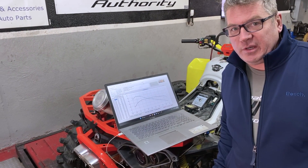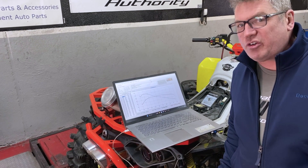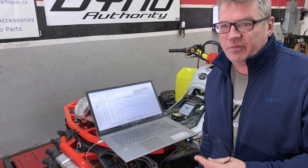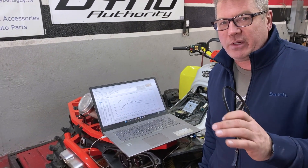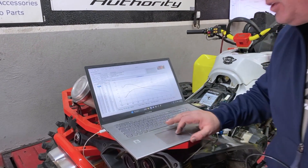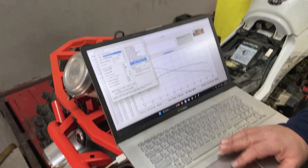So here's what we see. It's extremely rough off the bottom, and when we're watching the air fuel, we see the exact same things. You need a little bit of acceleration fuel as you're going through, but not this much. The numbers we'll be looking at are anywhere in the 12s — anywhere from 12 to 13:1 or so — that's 12 to 13 pounds of air to one pound of fuel being measured coming out of the tailpipe. Right now we're in the 11s.